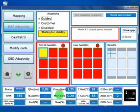We need the manifold absolute pressure to be working in a normal way. So on idle we have 0.30, and when we are on full power we have 1 bar or above, if we are talking about turbo cars. But aspirated ones stay, however, under 1 bar or so on. Here you see the cursor in the exact position.